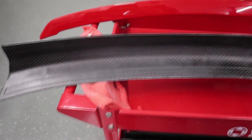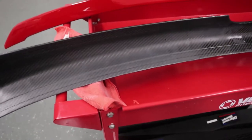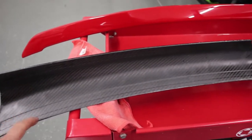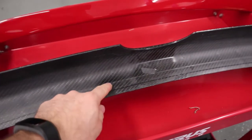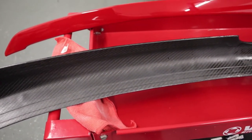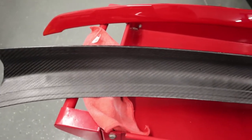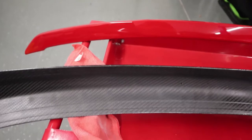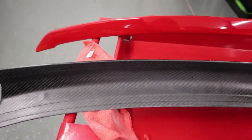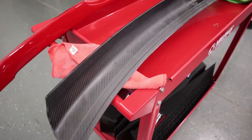At this point, the carbon ducktail spoiler is ready to basically be installed. To apply the double-sided tape, we are going to first rub down these strips — you can kind of see the indent. We're going to rub that down with isopropyl alcohol, a 50-50 mixture of water and isopropyl alcohol, and then we're going to do the same to the trunk. This ensures that the 3M double-sided tape bonds correctly to both the carbon and the OEM paint. We'll do that real quick, probably off camera, as it's a little tedious, but after that is done, we will go to installing the spoiler.